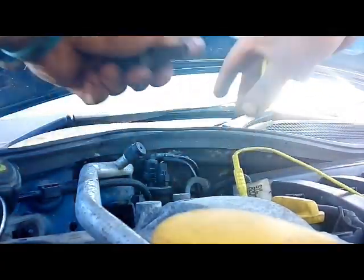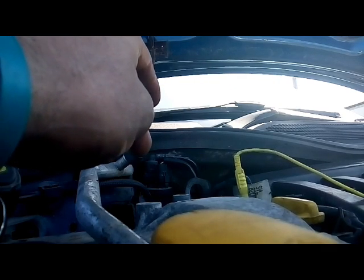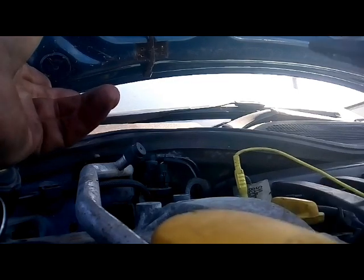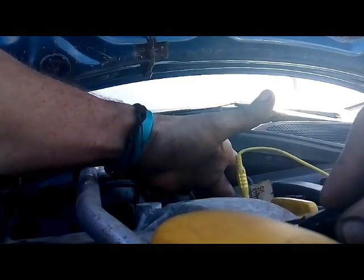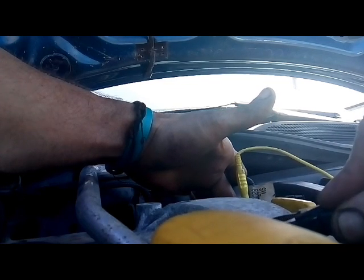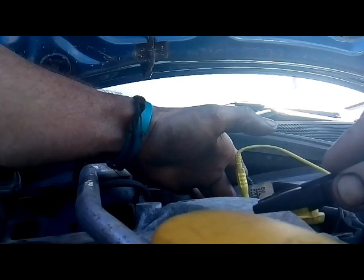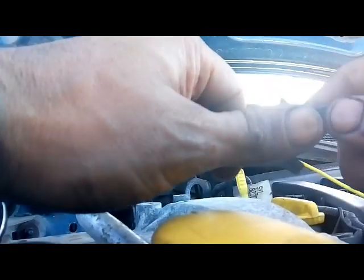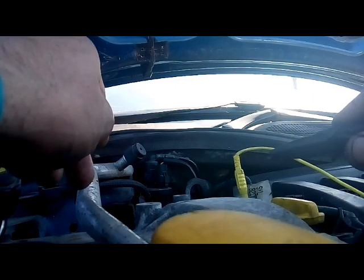Connecting the multimeter wire back up, I'll quickly join this onto a ground to see if we get an engine tone change as the valve timing changes — nothing, no change at all. I can definitely feel it click, but it's not changing the engine tone. So it's getting its control signal, and if I make it work nothing's happening — it could be a faulty phaser pulley, or something in the solenoid itself that's clicking but not actually working. I need to do further investigation.